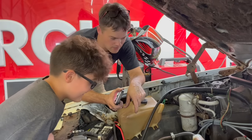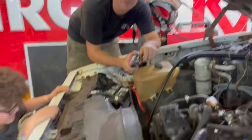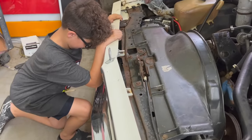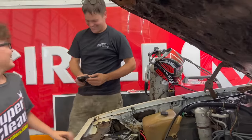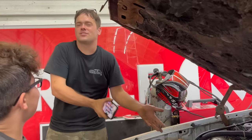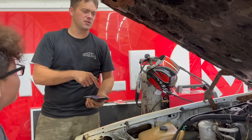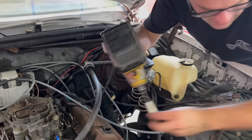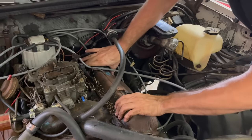It just needs a little bit of tuning and she'll be a hot rod. We need to see what heads it's got. Oh my gosh, I can't believe it's got a four-bolt main 350 in it — I have not showed this the respect it deserves. That casting number was also used for 302s back in like '69, but I doubt that on this one. Now we're super curious — does it have good heads on it too?